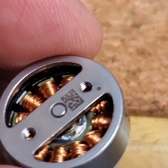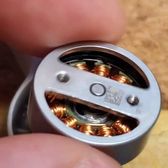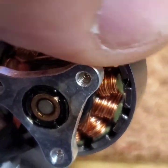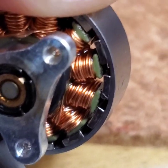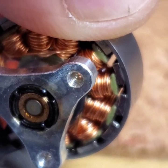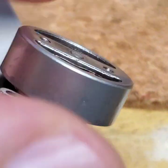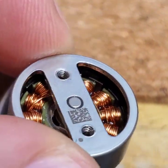In our case, somehow I'm very careful, but somehow a piece of sand gets inside this motor and it basically gets stuck. The problem is when the sand gets inside the motor, as you can see, there is a very small fine space between the coils and the magnets — extremely fine. So if you get sand and try to run the system, you'll create a sort of paste that will get even more stuck. It will be like a creaking, and you will feel the motor barely going back and forth.